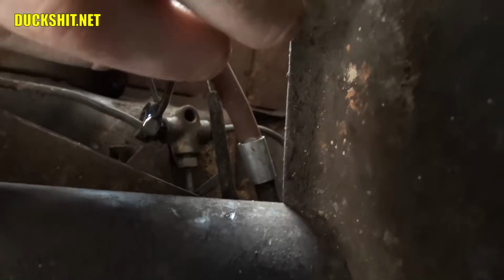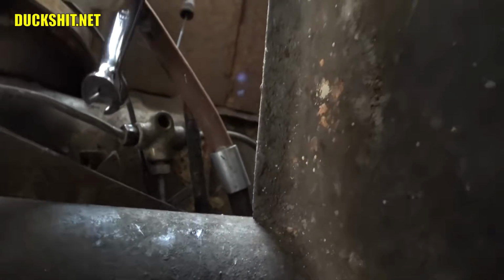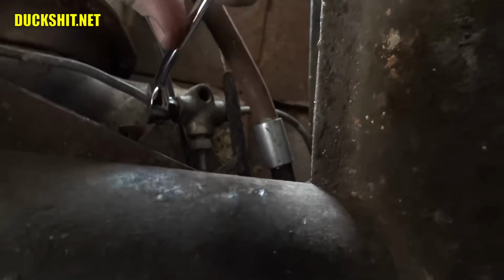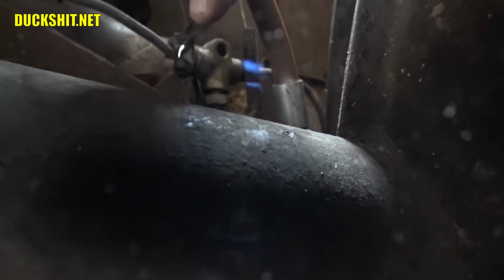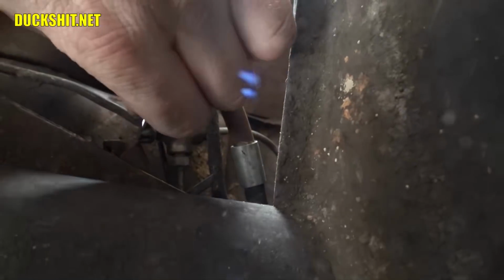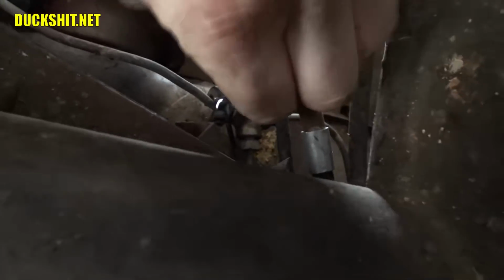All right, these wrenches are really cool. I'm trying to shoot this for you guys with two hands here. This is not the line I'm going to loosen. I'm actually going to loosen this one, but I don't know if I can. Well, it looks like I can. It has a split end on it, but it's five-sided, so you can slip it over this like this and then lock it onto the nut and then loosen it. They won't spin like they will on an open-end wrench because they're contacting the nut on most of its corners. So, get that back off of there.